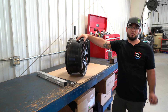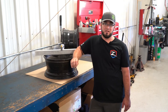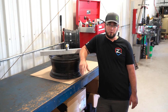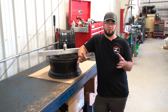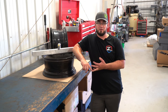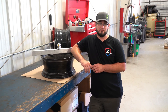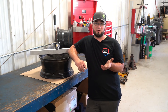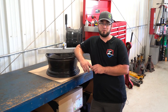Just because it is so simple and easy to understand, it's easy to measure. That's pretty much going to cover the very basics of measuring wheel backspacing and what's required for certain vehicles. Now if you're questioning what's required for your vehicle or the lift kit you're looking to purchase, go to the website and check on the lift kit itself. On the left-hand side of the screen you're going to find wheel and tire fitment combinations with a lot of other specs for that kit — that's where you'll find the specific information for your vehicle. Until next time, check us out on Facebook, Instagram, and shoot us a message if you've got anything you want to see us talk about or questions: tech-zone at ridefox.com or any of our social media platforms.